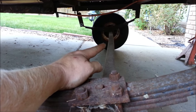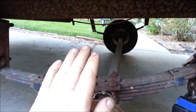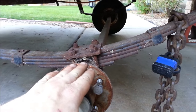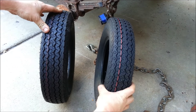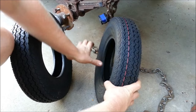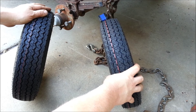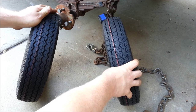So we can use some jacks and leverage to get that straightened right back out. All trailer axles do have a bend to them — they have a bow up in the middle. The reason for that is, once you put weight on it, it leverages out on the tire, flattens out the middle, and makes the tire run smooth and level. So an unloaded trailer, if you're driving behind it, will have two tires pitched in slightly. As the load applies to the axle through the leaf springs, it bends the axle down and they level themselves out. You'll see trailers on the road that have been way overloaded and they're bent out, or there's no load and they're permanently bent — that means the axle had way more weight than it was ever intended to handle.